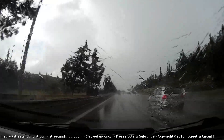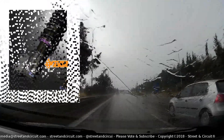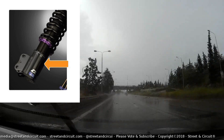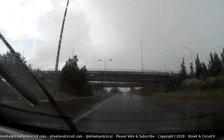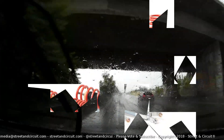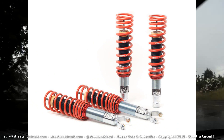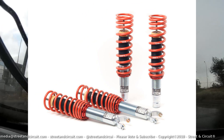If you can get a coilover that's got a separate independent bottom bracket, that in my opinion is a better way to go. Bear in mind that may be a bit more expensive and the suspension is going to be a little bit heavier because there are more separate components. The coilover suspension which doesn't have the bottom bracket — you're more limited on ride height adjustment, but you're going to be more close to the optimal ride height adjustment according to the manufacturer of the coilover suspension.